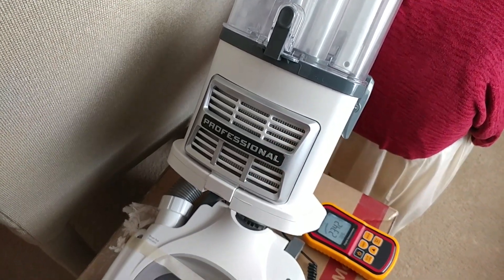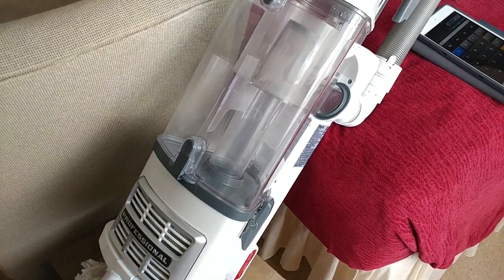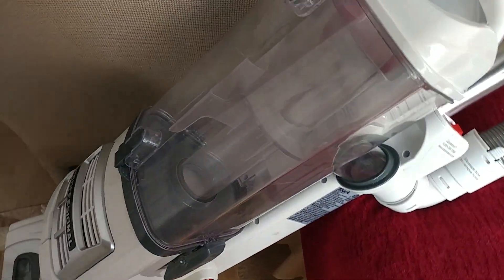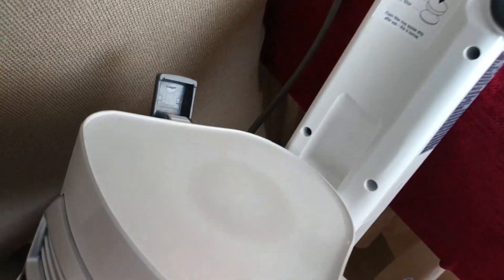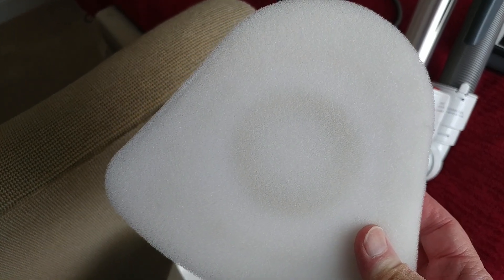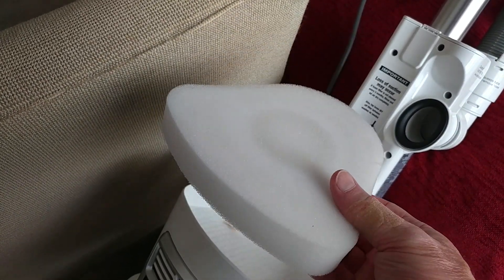The sealed measurement was essentially zero — I measured like 6 — but it's sealed and fine. There's a giant rubber seal around the very bottom part of the bin. It's got a very basic cyclone assembly, and you can already see that even in one use: there's a little tiny dirt spot and a ring right in there. The cyclones aren't really all that great at separating dirt — just a few minutes of use on a rug that isn't really that dirty and you've already got a little ring.